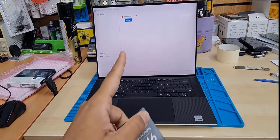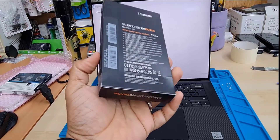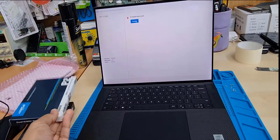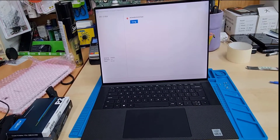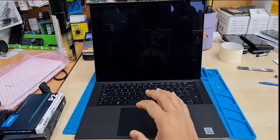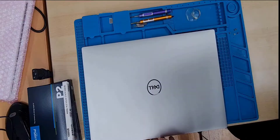It's pretty simple. The good point is all the latest models come with very simple steps to replace things, especially Dell. As you can see, there are two SSD slots — both M.2 NVMe. This machine takes two slots, so you can put two SSDs at the same time, but I'm going to do only one.